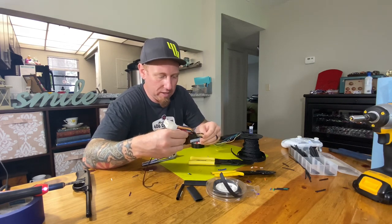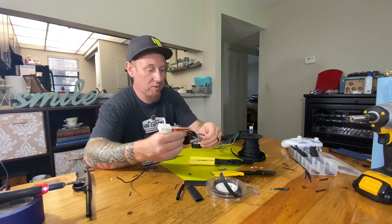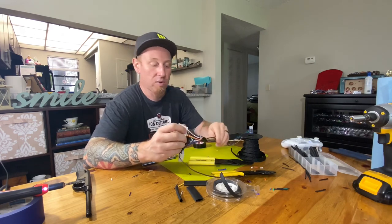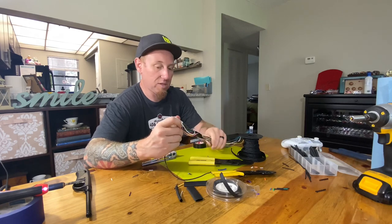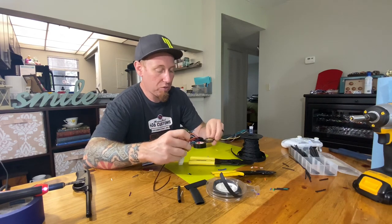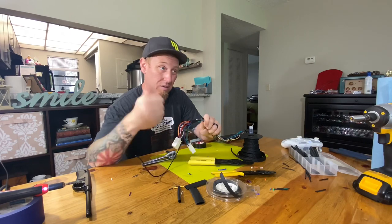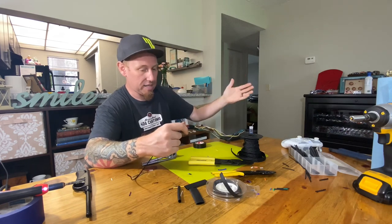The amplifier harness has a blue and white wire. The instructions don't say exactly what it is, but I'm pretty sure that's the remote wire to tell the amp to turn on. You can use this amp with factory or aftermarket decks — with an aftermarket deck you'd use its blue wire to the blue and white wire. There's no red wire, which is usually an ignition switch wire, so I wired the blue and white wire to the ignition switch wire of the factory harness. When the ignition turns on, it sends signal through the remote wire telling the aftermarket amp to turn on.